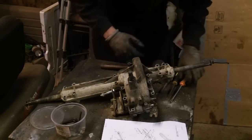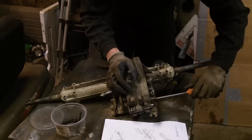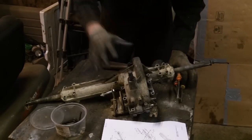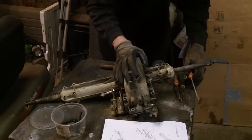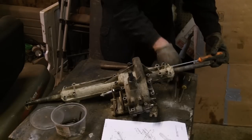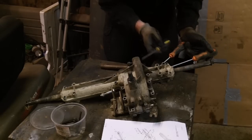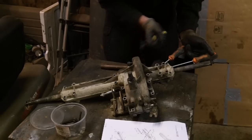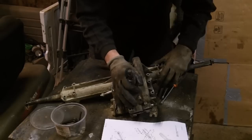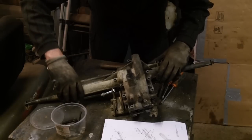Now in this case, this one managed to pop already across the front. As you can see, I can get into it and move it. Now, the reason why I have multiples of these is if it was glued down with a really good RTV sealant, then what you would do is start on an edge where there's reinforcements in the case, tap it in, then tap the next one in on the next reinforcement, and from there you would work around the case. So, since this one seems to have come loose quite easily, we'll move the brake lever a little, and up we go.